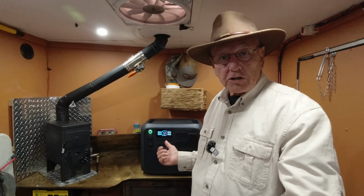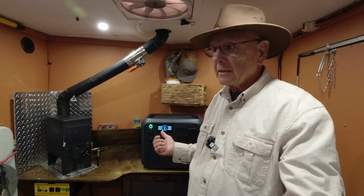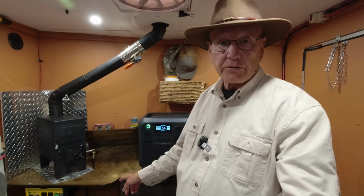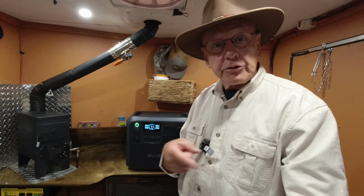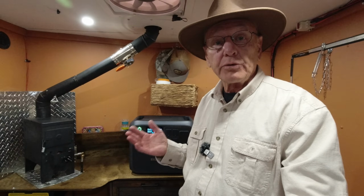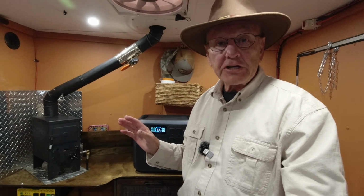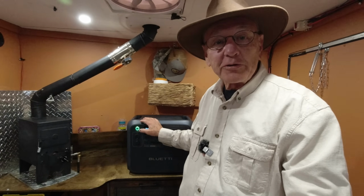So Linda and I brought this along to do the review on this trip, and then we actually ended up depending on it last night. Two things happened. When we got to our campsite, I had a circuit breaker blown on our battery system down here, and I wasn't getting any power out of either battery, and the refrigerator was off, so we immediately plugged the refrigerator into this, but it made both of my lithium batteries in my power system here shut off. There was no voltage at all coming out of them, and they eventually reset themselves. But in the meantime, we had to depend on this to run the refrigerator.